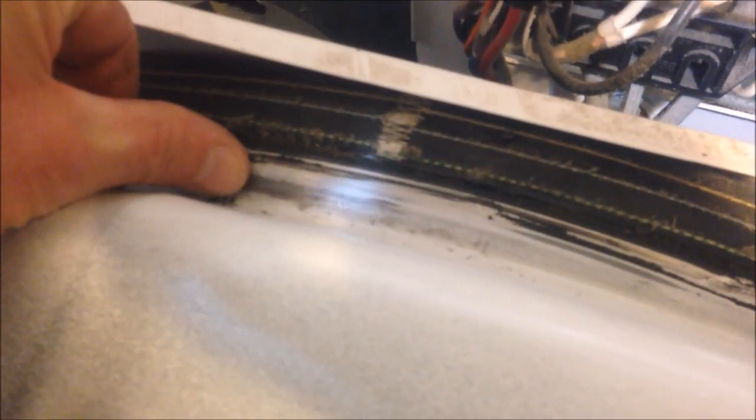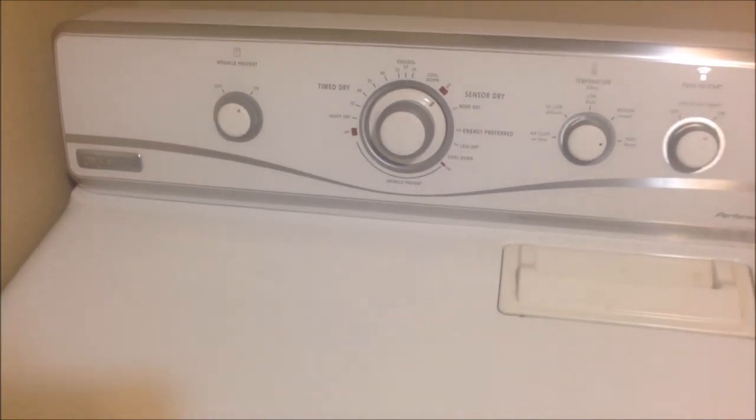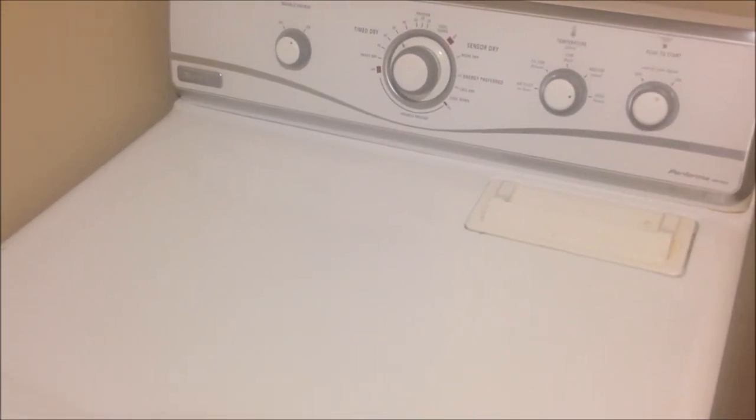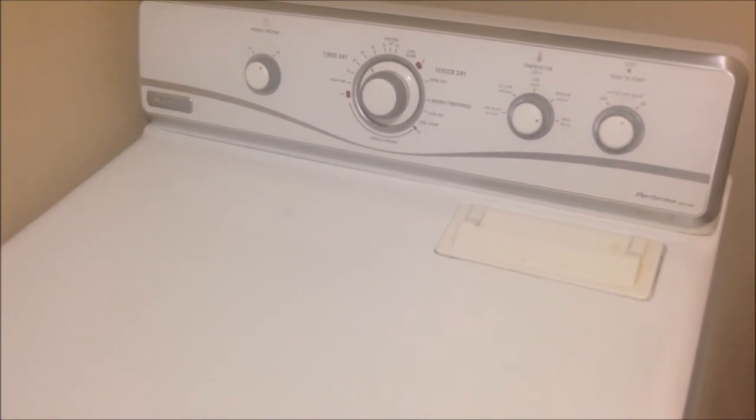I think from the last time I filed that little weld down a little bit. It's really not a whole lot there. I may file it down a little bit just to quieten it down. So I took a round file and filed down the weld where the drum is seamed together. It really wasn't a whole lot of material to grind down, but I removed some and it may or may not have helped. The noise that we have now I can live with — it's actually got some clothes in it now — so I'm just kind of stuck with this bump, bump, bump, but it is so much better than it was before. $20 well spent.